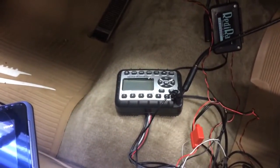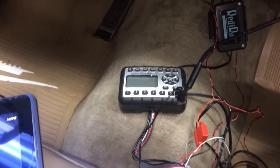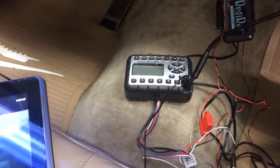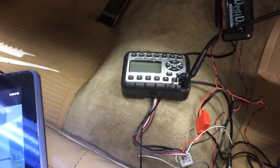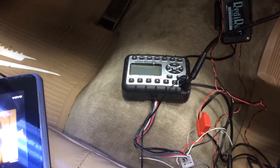The good thing about the Jensen radio is it's a two-wire power hookup — 12 volts DC and a ground. There's no memory wire needed, so if you have your car in long-term storage, there's not really a worry about draining the battery if you leave your battery connected. There's a memory backup in there that's good for about 30 days once the power has been killed.